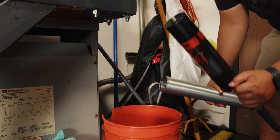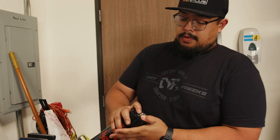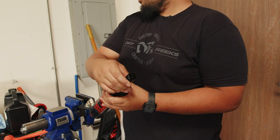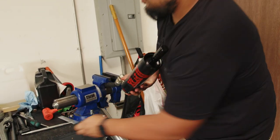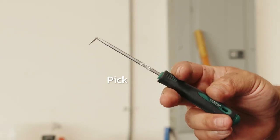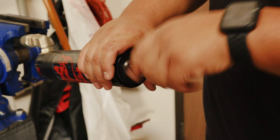With the seal head out of the way, dump your oil in your oil bucket and get that reservoir taken apart, because you're going to want to take out the IFP and replace the seals in there. Sometimes you can push the end cap in by hand but sometimes a hammer will help. Just knock that in place — there's a circlip in the reservoir that keeps the end cap in place, so you're going to want to take your pick, being careful not to scratch the inside of the reservoir, and take your end cap off.